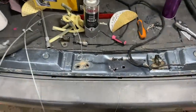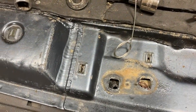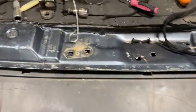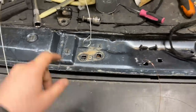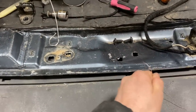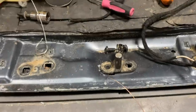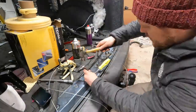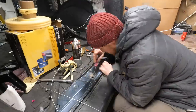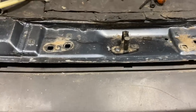What I've just made a start on now is moving the latch. Normally you've got a latch here and a latch here - we need to move it into the middle. Underneath you can see there's a plate which has got the thread in that holds it in place. There isn't one in the middle, so you've got to fish it across. There's a retaining loop in there that holds it in place. You knock this down to pull that bit of metal out of the way, then fish it over with a piece of wire, put a bolt in, and there we go - striker plate has been moved over.